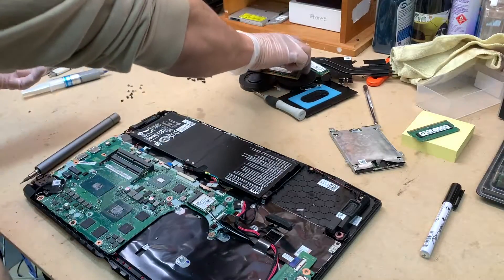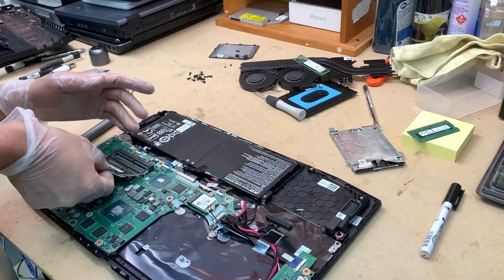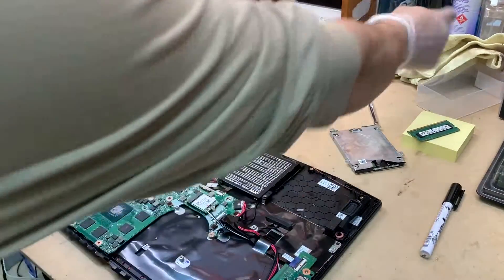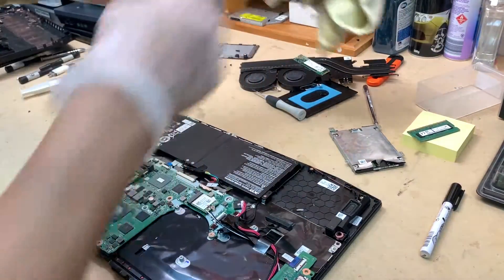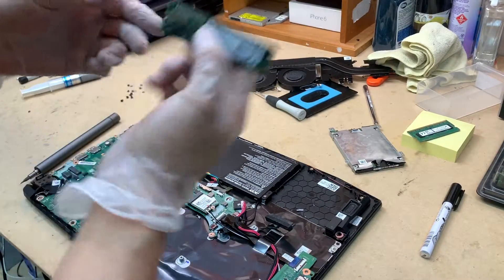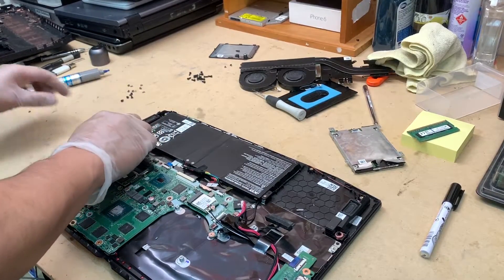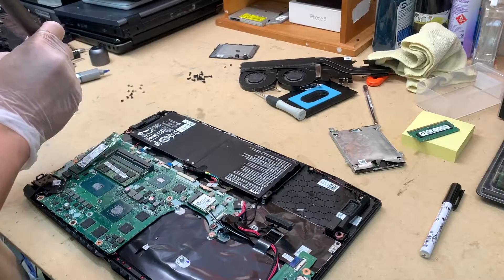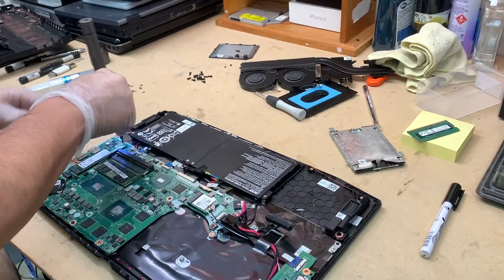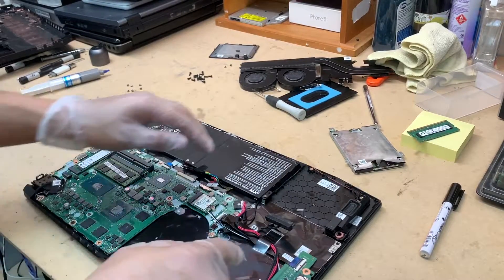Let's put the RAM back — I'm not going to upgrade the memory but if you have an empty slot you can do that. This model comes with 256 GB, and a lot of the time this slot is actually empty. So if you just have one drive on this model, you can be pretty sure that the SSD slots are available. Instead of replacing your hard drive, you can add the SSD on as an extra drive and keep the hard drive as backup.